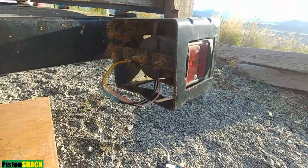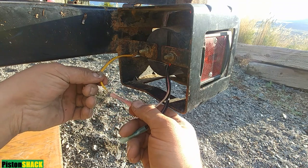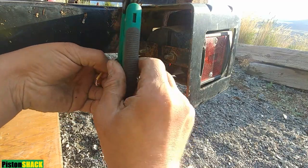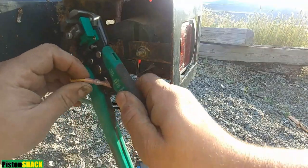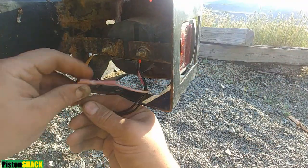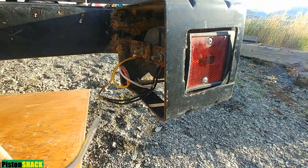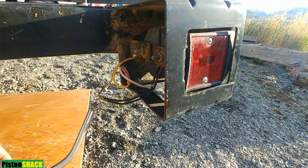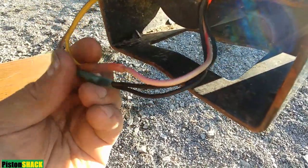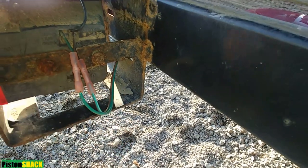I just connected my wires and they're not crimped yet — it's a good time to check. I checked and everything works, so let's crimp them now. There are two wires — make sure they're all tight. Hit shrink with a little bit of heat and do some melting. That shrink has melted and now it's all waterproofed. Same on the other side.